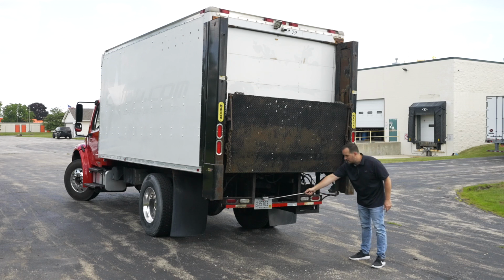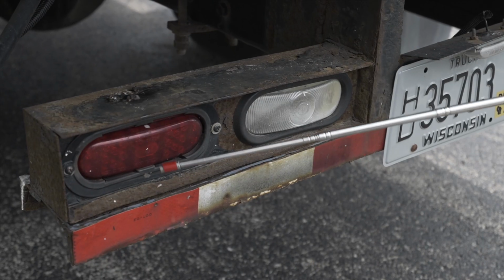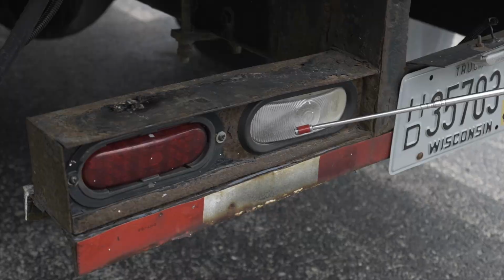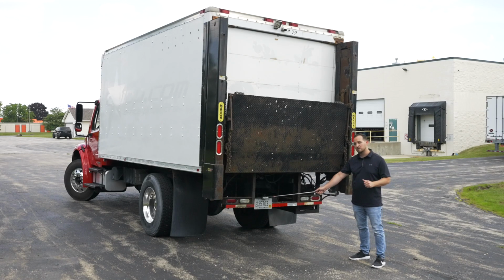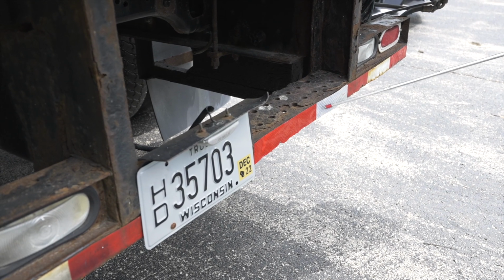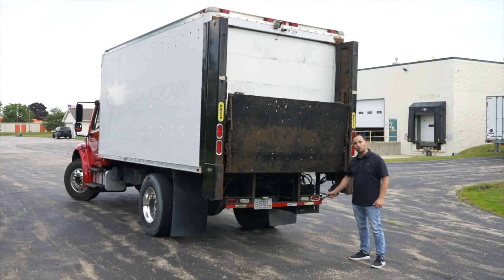On the bottom of the vehicle, we have some more tail lights and our reverse light. They're not broken, not cracked, proper color, clean and clear, on secure, same functions. The DOT bumper, it's on secure, not broken, not cracked. It has 100% DOT tape, which is on clean and clear.